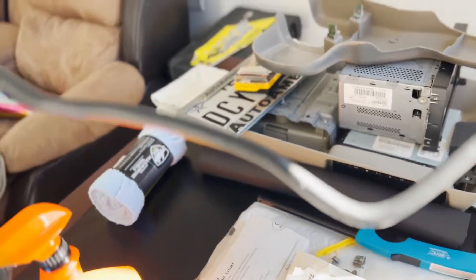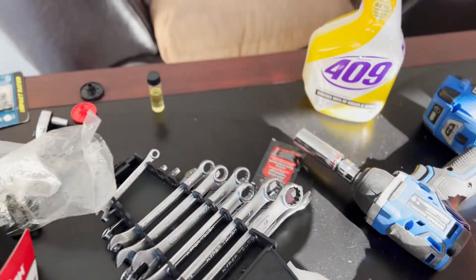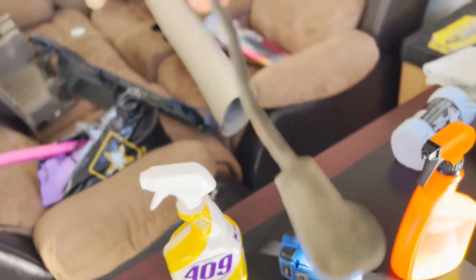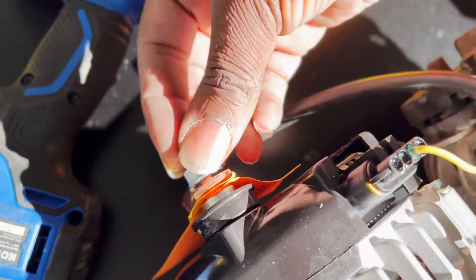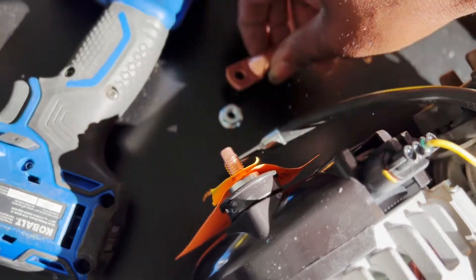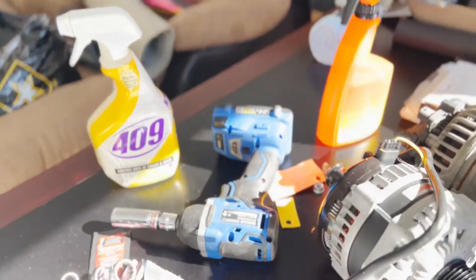The reason why I'm changing the battery cable is because one, the factory cable is too little for the power supply, and two, the cable connection is farther over on the Mechman. With more power you need a bigger cable.